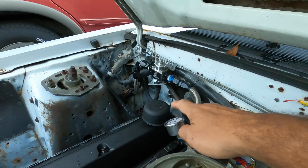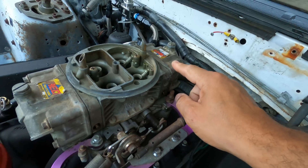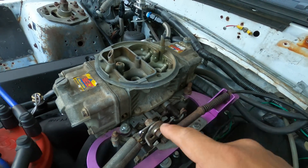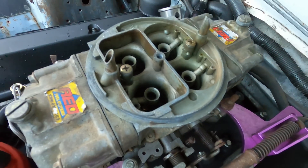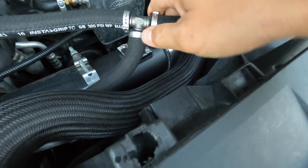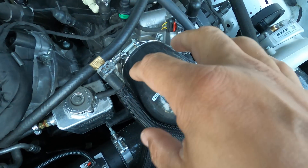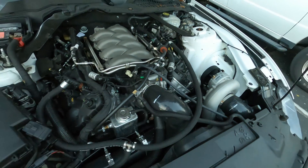Where you adjust it in the tune is what matters. On a carburetor you get about seven pounds of fuel pressure from a Holley Blue pump. Inside are two small fuel bowls — a float with a needle valve that stops at a predetermined level. These EFI cars are completely different. You can't unplug the MAF sensor on a MAF-operated car and expect it to run properly, especially on a Ford Coyote.